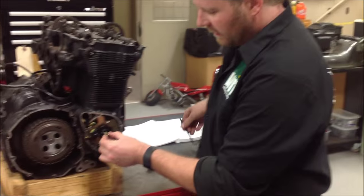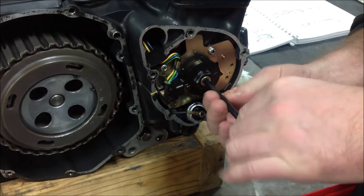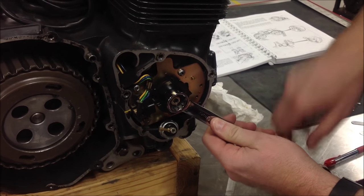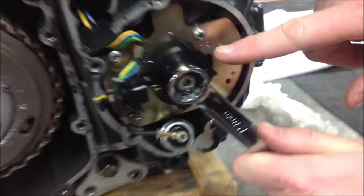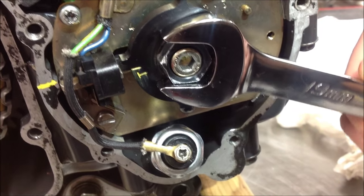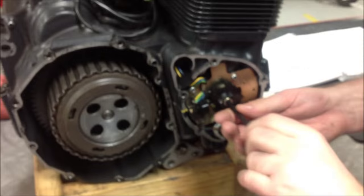With these being motors we use in class here, this Allen bolt is what holds this rotor in place. And what I was noticing is as we were turning the engine, this was moving, but the engine wasn't. Can you see that? Get a real good close-up, as close as you can on that. I'll switch to this end, just so you can see. That bolt will not move, and you see how the rotor's moving. Yep. Not good, huh? So we decided to investigate. We decided to take this apart.